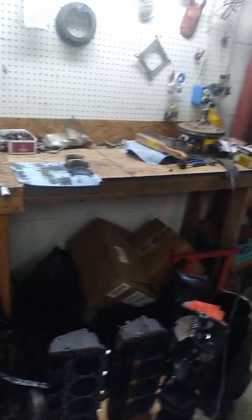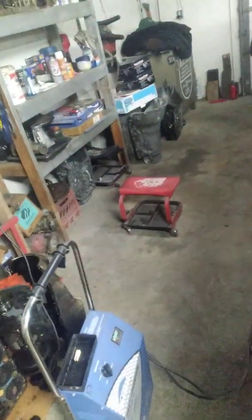I turned the battery charger back on so we'll make this easier to see — I'll turn this light off over here, that'll help. What the noid light should do when you're cranking it over is blink, flash, whatever you want to call it. All right, we've got it — it's flashing.